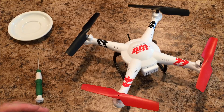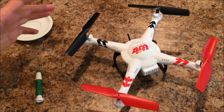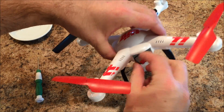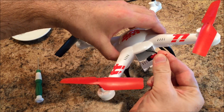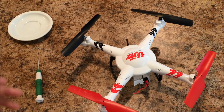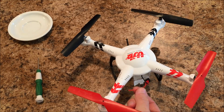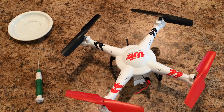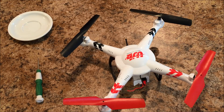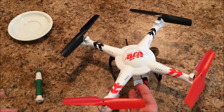The reason I haven't done the video yet is because I haven't had a motor fail recently, and I actually still haven't had a motor fail. But what I did have happen is my positive battery lead came off the board internally. So what I'm going to do also in this video is re-solder this to the board and show you how to hot glue the wire down to give it a strain relief to prevent this from happening again. And if you are doing a motor replacement, it probably would be a good idea to do this at the same time, because this is definitely another weak point in the quadcopter.